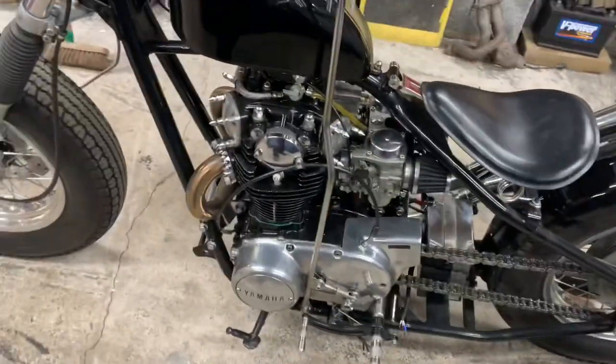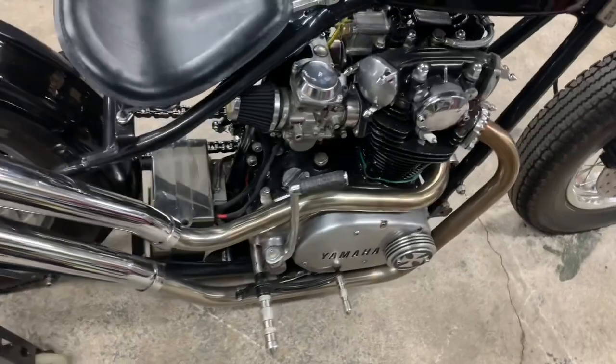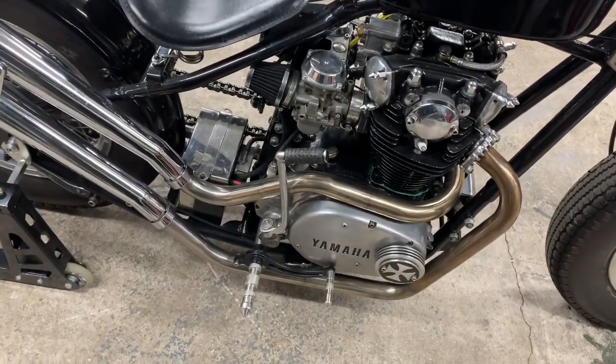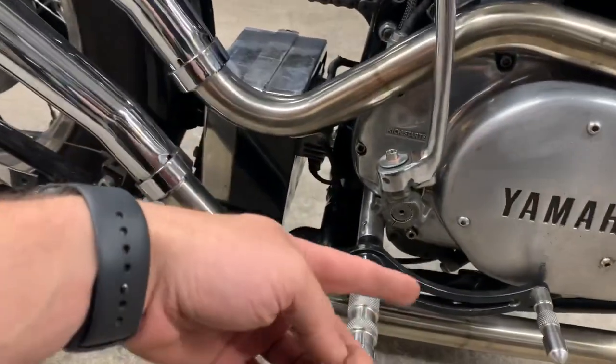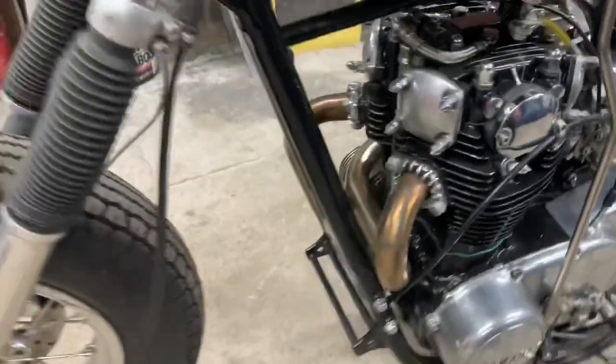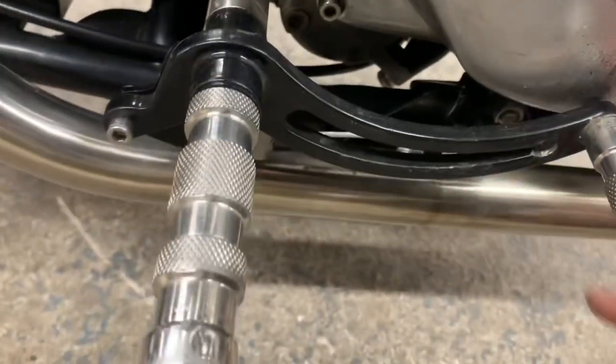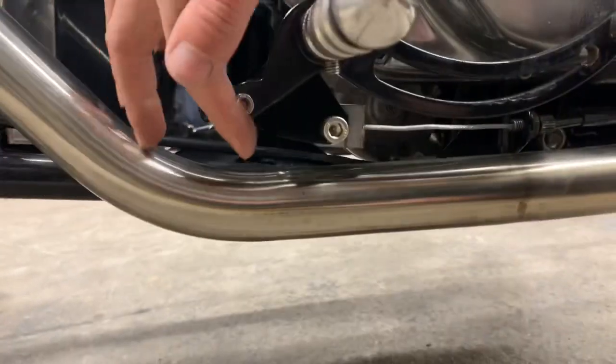Suicide shift, foot clutch. Where most people differ — this is my back brake and this is my clutch, because like most people I put my left foot down when I come to a stop. So I wanted a right foot clutch, which is really simple. The original cable for the clutch just comes up, mounts to there, swings down underneath the engine. On the frame, the original pegs — all I've done is a little bracket, little adjuster. These are the original front controls, I just made this little bracket that bolts to the back, so instead of it pulling up it's pulling back.